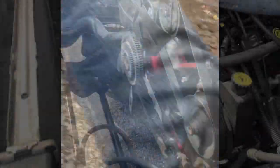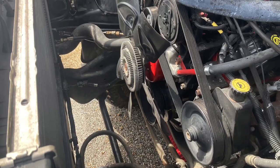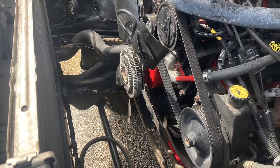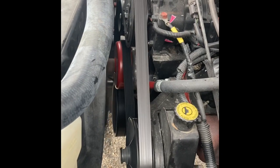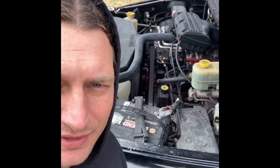From this part of the process on, I had to get to a track meet and I was just trying to button everything up. What happened was I didn't get the tensioner arm tightened enough and my belt sounded bad. I replaced the harmonic balancer and put everything back together and it's running.